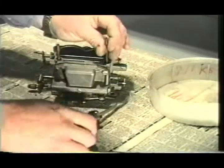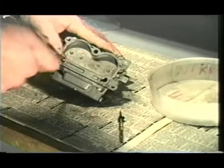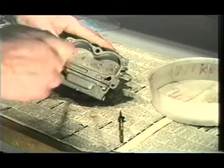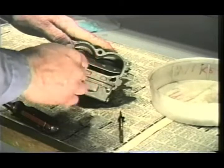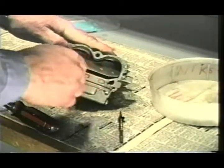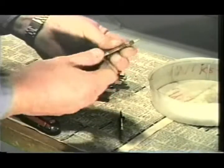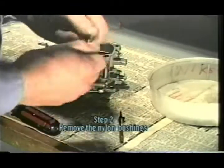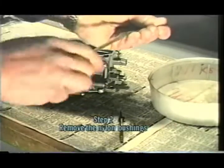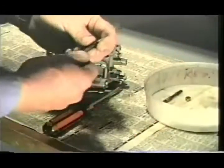It's always good to remember that you need to completely strip your carburetor down, especially if it's been sitting for a while and it's very dirty, because there are going to be passages in there that have dirt and varnish from the gas. As we remove the needle valves, we're going to find a little seat that's going to have to be replaced. On your needle valve you have a little nylon threaded seat that needs to be replaced — just go ahead and take them off right now. Keep your parts in your container.